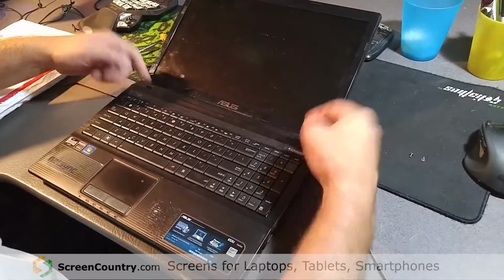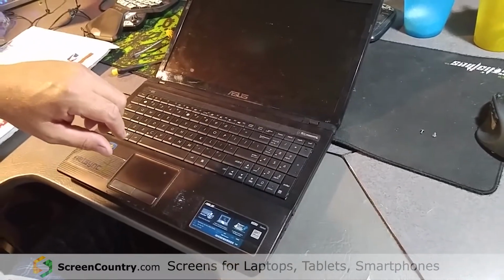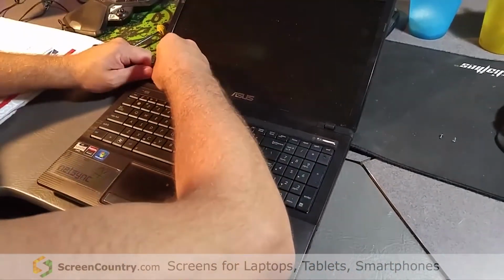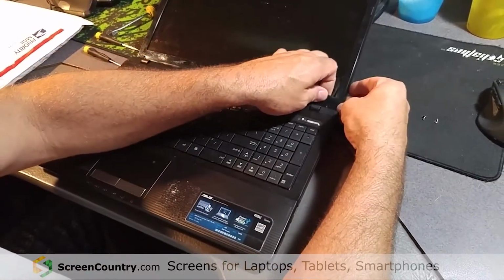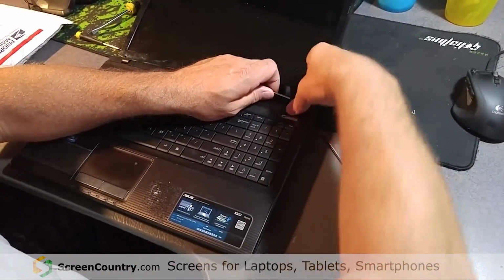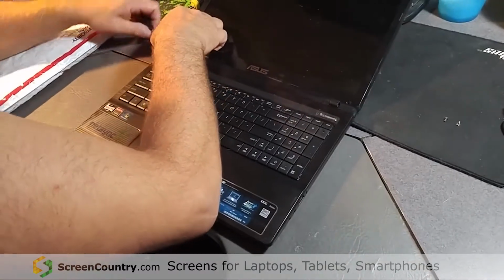You just have to pop these two lips up here and then just go around and pull the trim bezel off. It's just basically little clips that hold it in place. So now I'm going to look for a little screwdriver, regular head. And they just pop up, just like that. It's really on there. I already had this off once, so it should actually come out pretty easy.